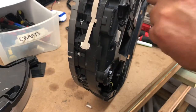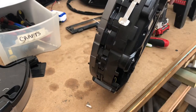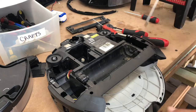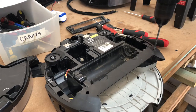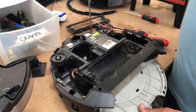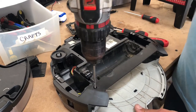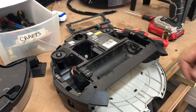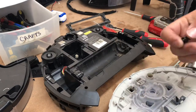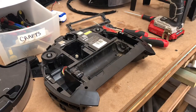Here we have the array of all the sensors. We have two tabs — those are our springs. While you're in here, blow it off and clean with 91% isopropyl alcohol. Now let's go ahead and split the body — we're going to remove one screw here. Some of them don't have this one; some have one in here. This is a part that everybody hates. Pick it up — oh, look at all them goodies in there. There's the rest of that broken piece. Dump that out and clean it out — that's the top case.